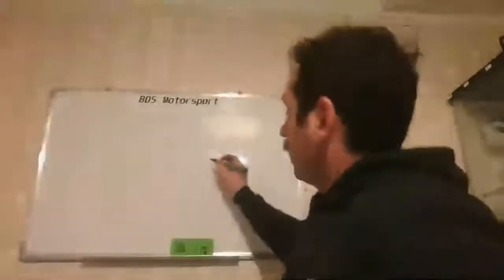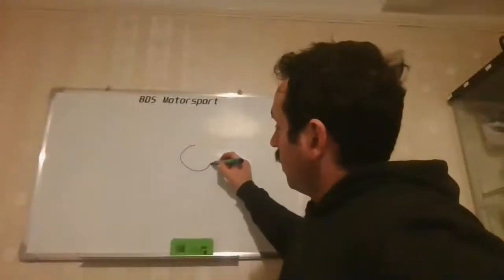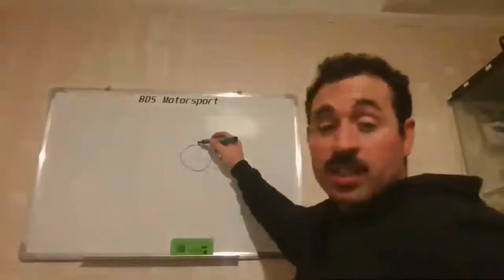Because what happens is, when you tune it, it happens on all the engines. The reason it makes more power is because you're increasing the cylinder pressure. More cylinder pressure, more temperature, everything goes up. So what will happen is, when you increase cylinder pressure and temperature, the piston rings start to expand. Okay. And as you know, you guys know the shape of it, and they never touch themselves.